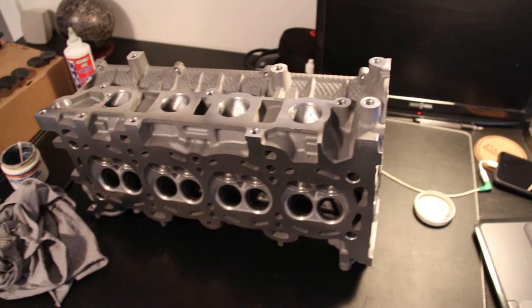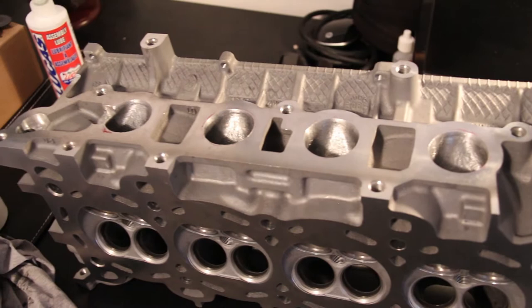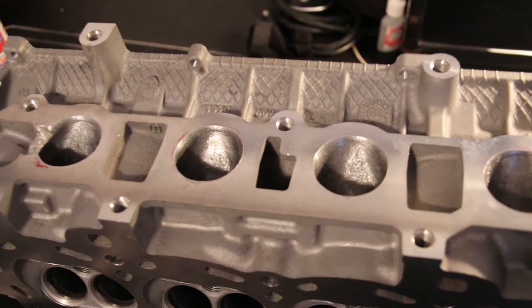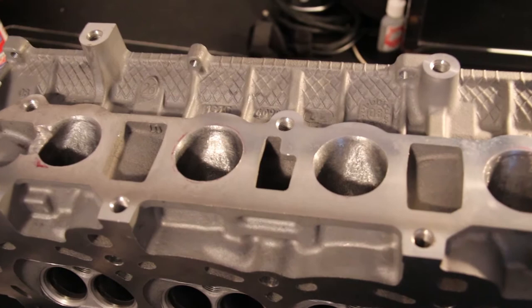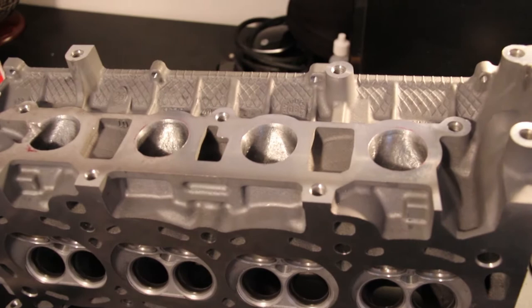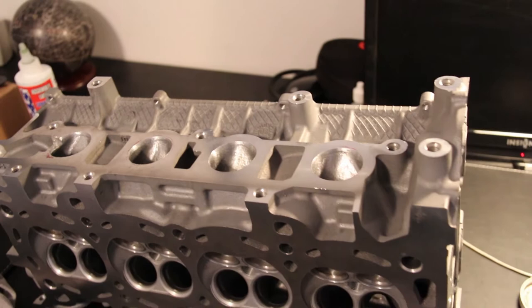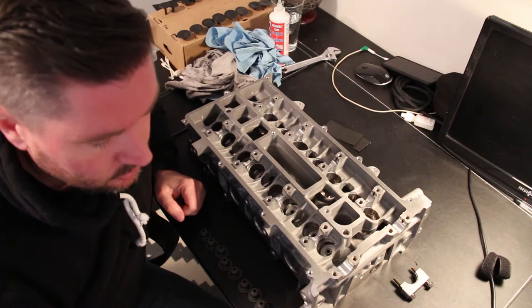I should also mention that while I had the cylinder head off and disassembled, I went in and did some polishing and a little bit of porting of the cylinder head. The intake and exhaust channels have been ported and polished - only ported close to the entrance where it mates with the manifolds, because I needed them to match up and didn't want any big lips there. While I was in there I did a little bit of polishing - you can see it's shiny and reflective. I didn't take much material away. The cylinder head is now going to start to become reassembled - we are ready to start putting this valve train back together. Everything's been cleaned again, no dirt, dust, or metal particles.